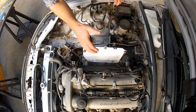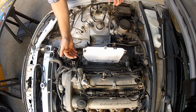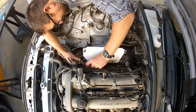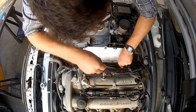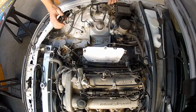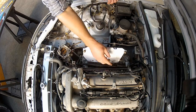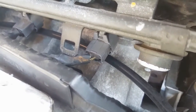I've loosened off those bolts — I haven't removed them — but now I can lift the fuel rail upwards, which should give me enough access underneath to be able to unclip this wiring harness with a pair of long-nosed pliers. If not, I may have to lever it off with a screwdriver. Both clips have now been disconnected — one I managed with the long-nosed pliers, and the one at the back required a screwdriver. Now I can pull the harness back and unplug each of the injectors.